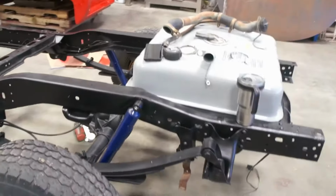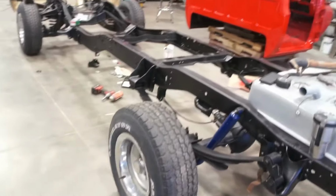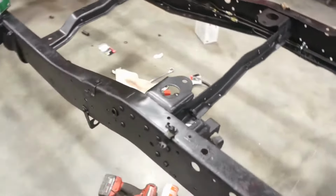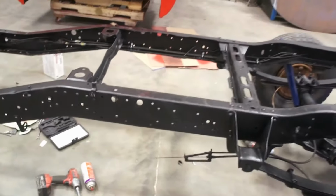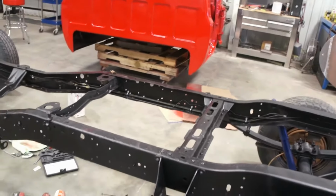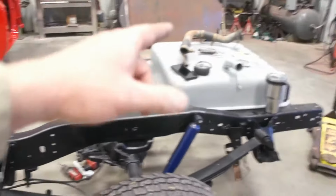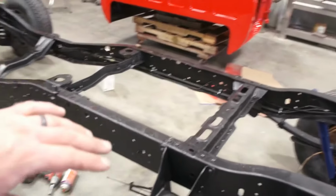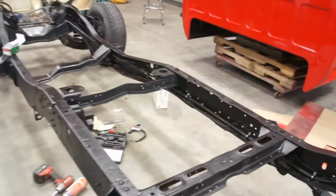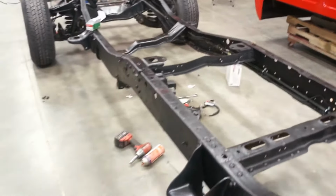Not that it matters. Now, this is an '86 square body GMC, second to last year of the body style. They were still using saddle tanks up here, tucked up underneath the cab, or at least halfway underneath the cab. I would have had to buy two new saddle tanks. I wouldn't have minded using the system. There's a lot more fuel lines involved, more electronics, twice the sending units, twice the tanks, twice the rubber filler hose. It's a pain to get out sending units to hook and unhook them if your cab is down. They're just kind of a pain.